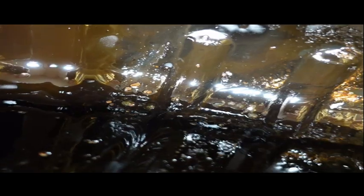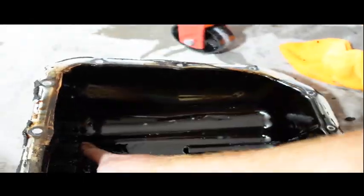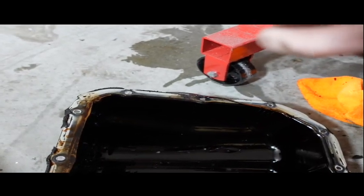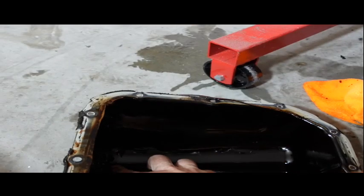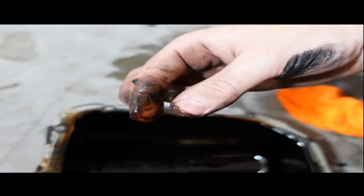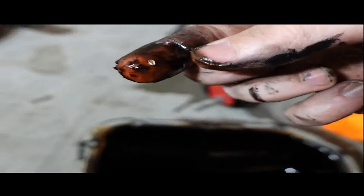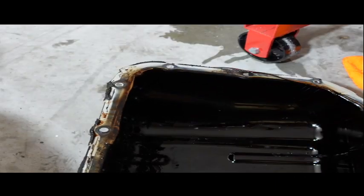We are not out of the woods yet. If you look down here, there are some chunks that look metallic, which is not great. It's hard to tell what half of this stuff is — it could be part of the sludge, but it feels a lot harder, a little bit like plastic. I don't know if it's part of the valve guides. We're going to have to tear this thing apart and see. You guys can see that's metal — so that is not good. You win some, you lose some. Next episode we will tear this thing apart and see what that material is.